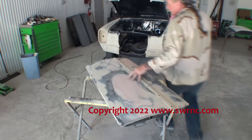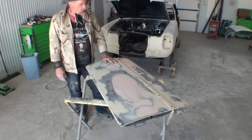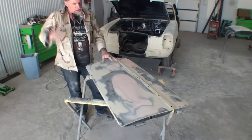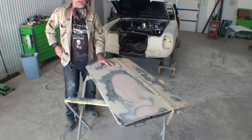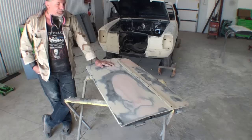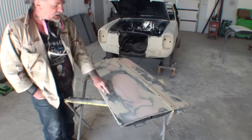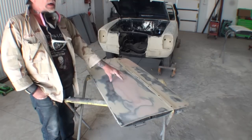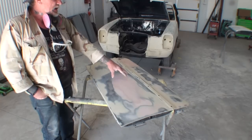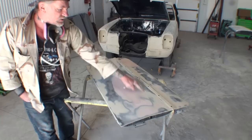What you're looking at here is a door that goes to a 1976 Mercedes-Benz. I've been working on this door for several days. You can see the body work I've been doing to it, and we've got a serious situation in this area right here. I have hammered and dollied this, pulled the dent out, slap hammered it, filed it down, and we still got a situation right here.